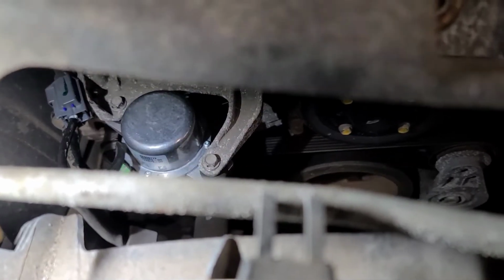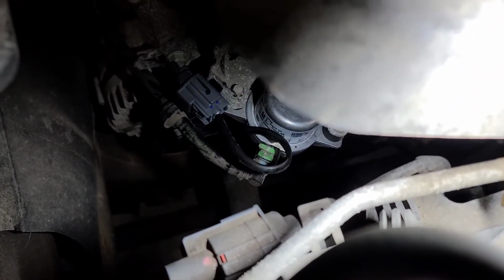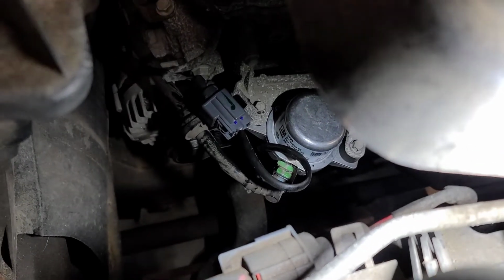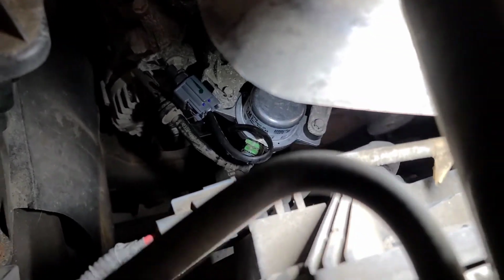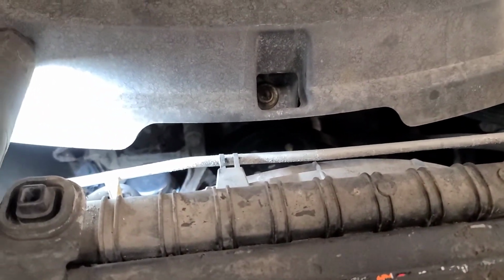So there's the new pump installed. I'm sure those bolts are not that tight. They're only 6mm bolts, so I just used a 1/4 inch on them. A little dielectric grease on the silicone seal, and a little bit of grease on the connector, and the connector's plugged in. Now we're going to use the scan tool to bidirectionally command it on and make sure it works.